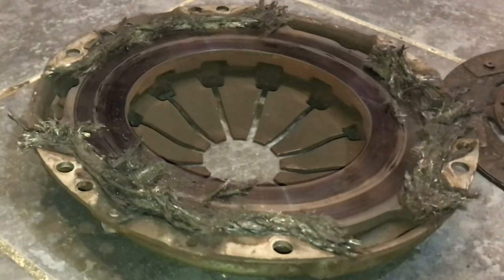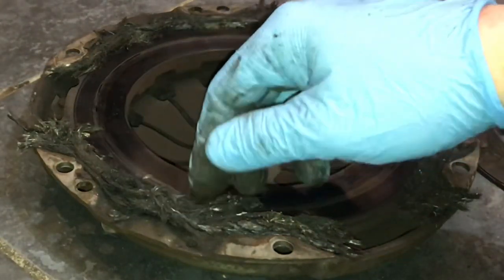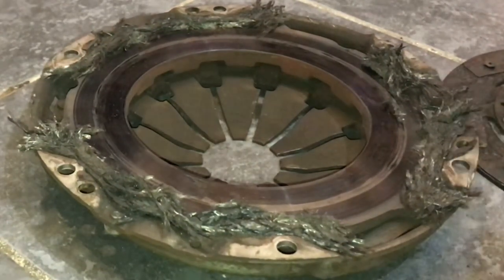And she's had knee surgery, so I don't know. I sort of have to suspect that she's probably been riding the clutch. She'd had a foot on the clutch pedal while she's been driving. If that's not the case, then a poorly adjusted clutch.